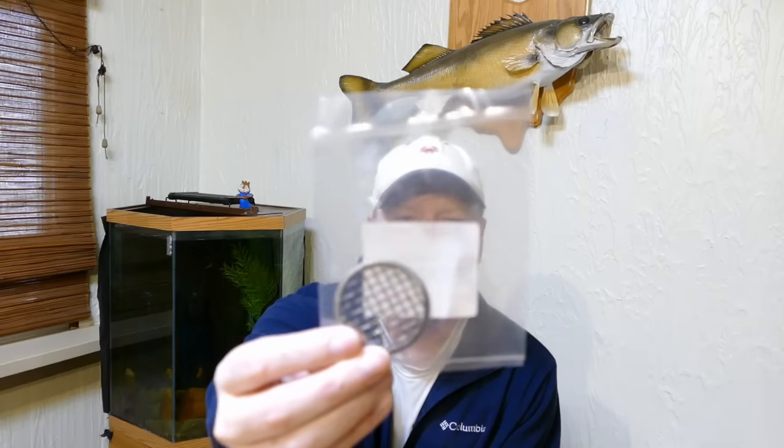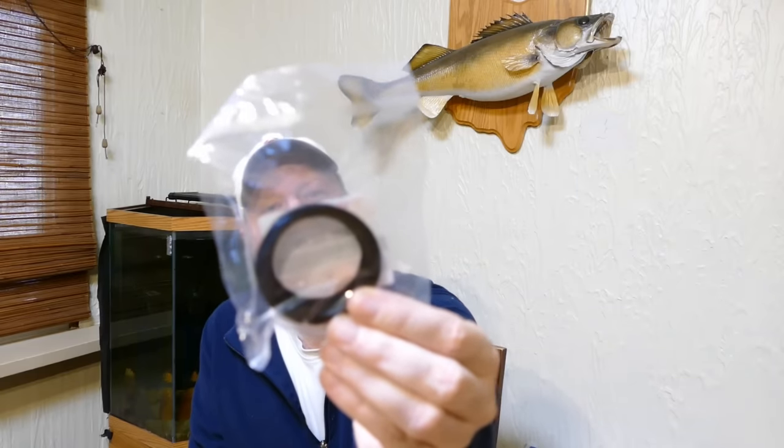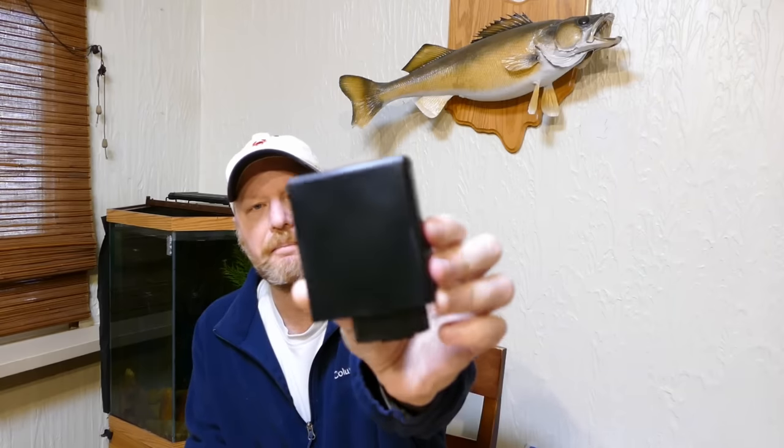It's going to be converted to a 20 horsepower motor. To do so, I have three parts. I've got the flame arrester — that is part number 1371089L00. I've got the silencer seal — that is part number 1383289L00. I'll include these in the description for the video once I complete it. And then there's the electronic control module, the ECM — part number 3-3-9-3-0-8-9-L-2-0.